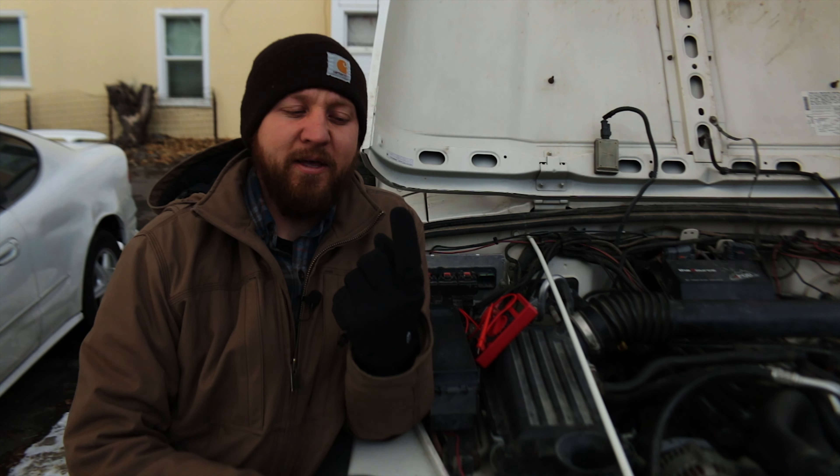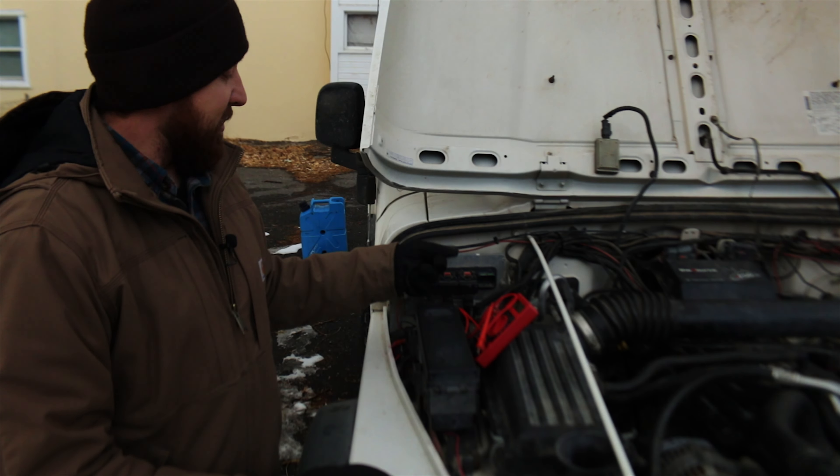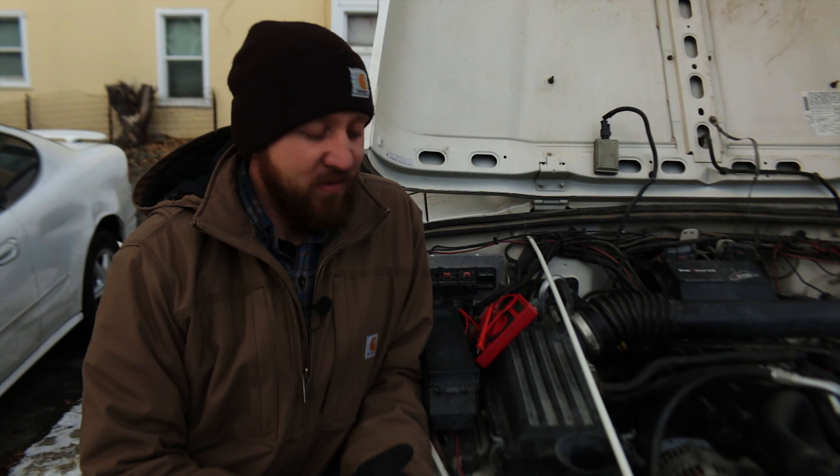That leaves one last issue. Remember I said there were four components to a Jeep charging system — and that's the regulator, which unfortunately is inside the computer on these vehicles. That really stings because it's expensive to replace: if you have an automatic it's around $250 for the computer; if you have a manual it's north of $700. I suspected that was the case, so I already ordered a computer — it's on the way. Once it gets here, we'll do a video on how to replace it and see if it fixes the problem. Run through these tests just like I did — it's the simplest, cheapest, and easiest way, and it really costs you nothing. Thanks for watching — we'll see you next video.